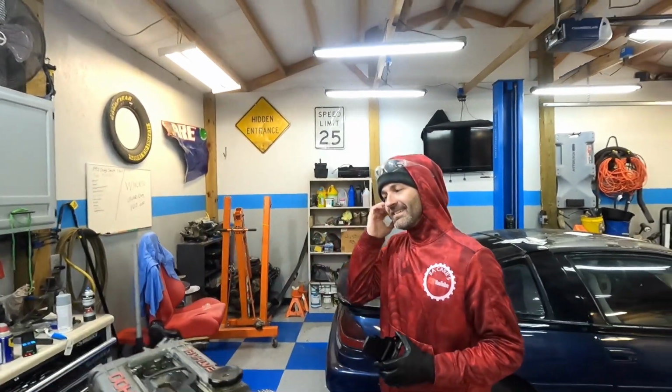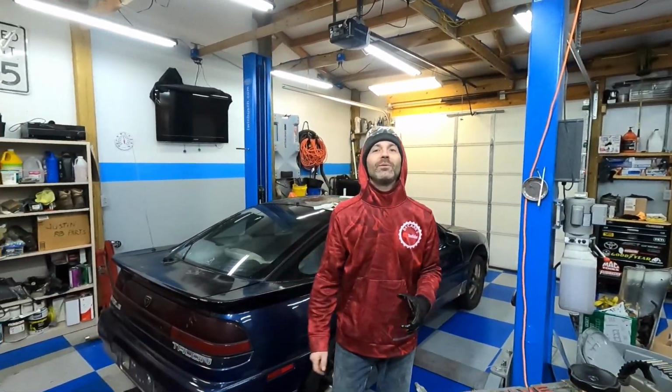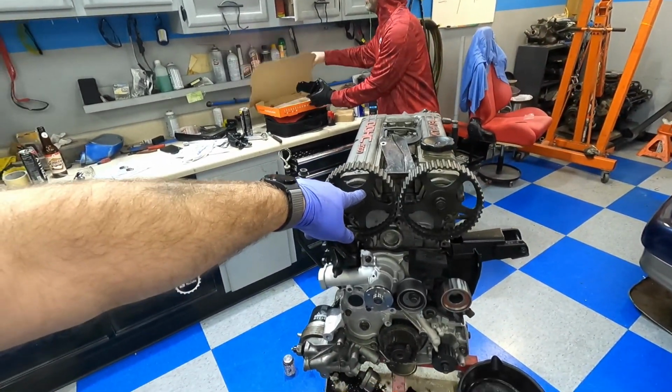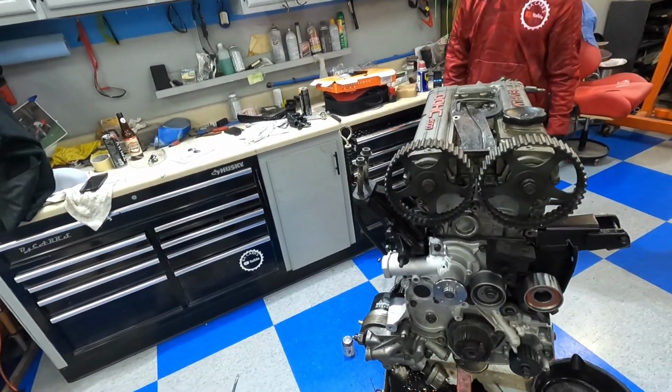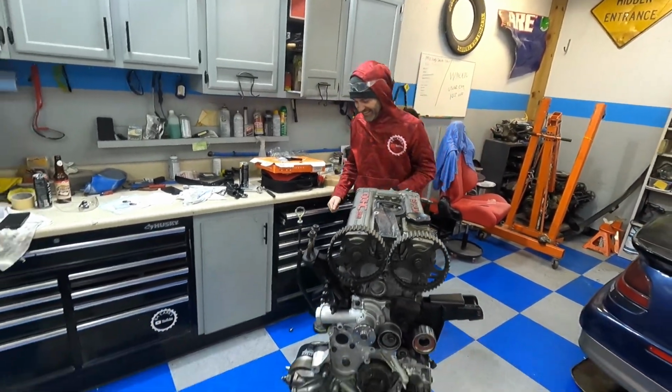Why do we do this to ourselves? I have no idea. That was a terrible decision on the coin flip. You know what? You shouldn't have let me flip it. You're right. Now it's going to leak because we're putting new cam seals in it. That's right. So, yeah, I guess now, since Logan flipped the coin, I'll try to get these gears off here and pry out the seal.